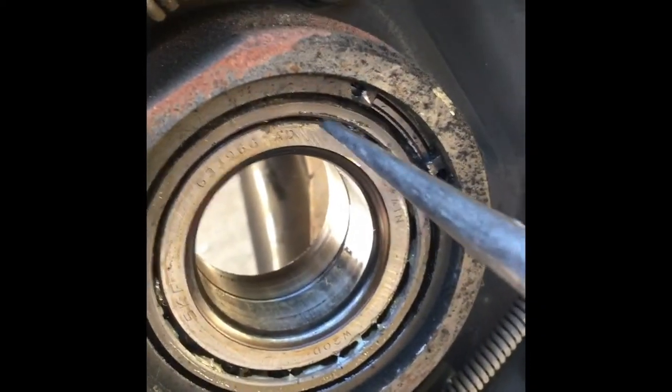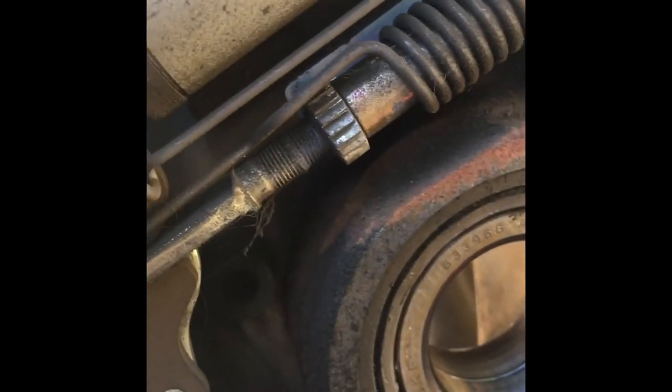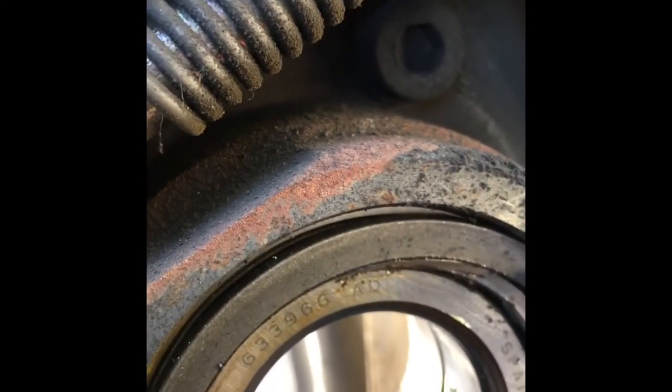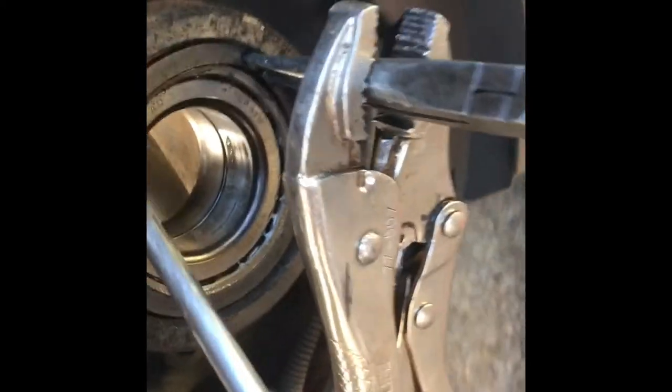All right, good deal. You give it a few tries, a few attempts, you should be able to master it. Screwdriver last time. All right, now just push in. Straight, nice and straight. Ready? Here we go. Look at that. That pulls it out. Now hold it still. I've got the vice grips on there. Now I'm going to use that little screwdriver. Put the screwdriver right here in the back. Just pry it out. And there goes your ring. There she blows. Don't forget to put that back when you get all done with the bearing.